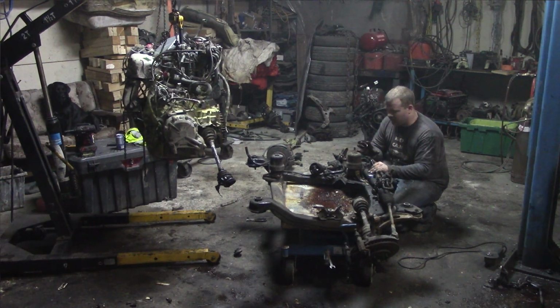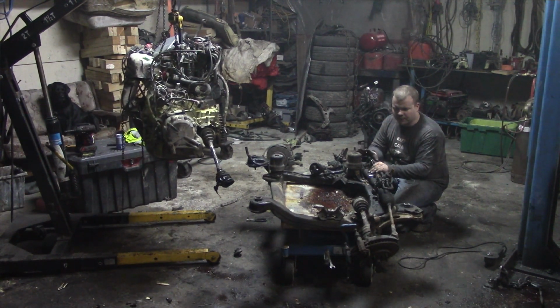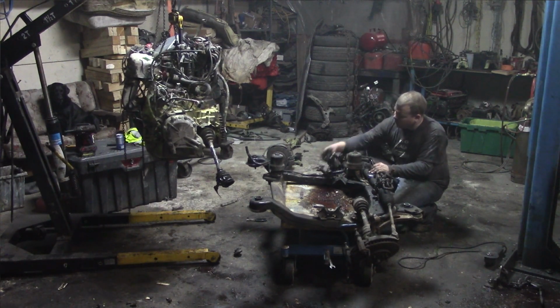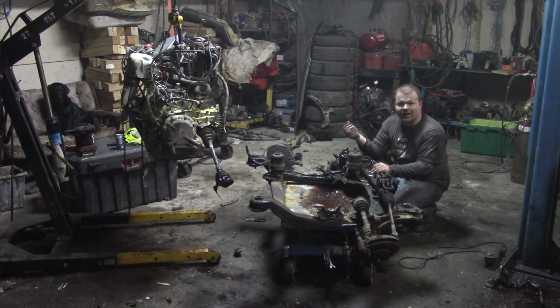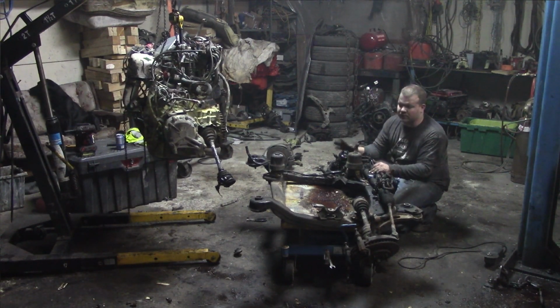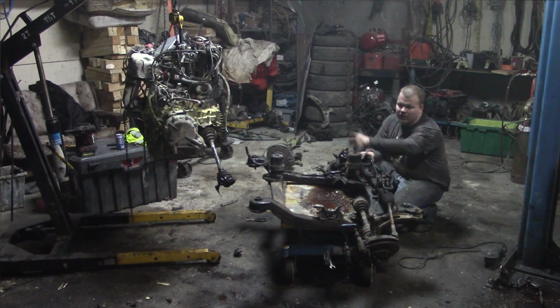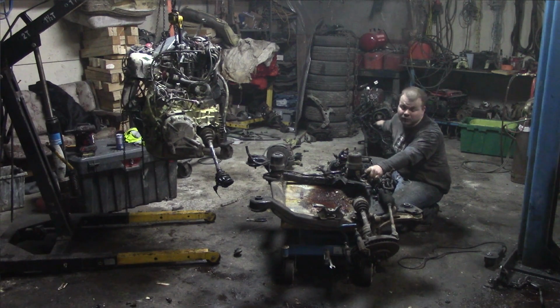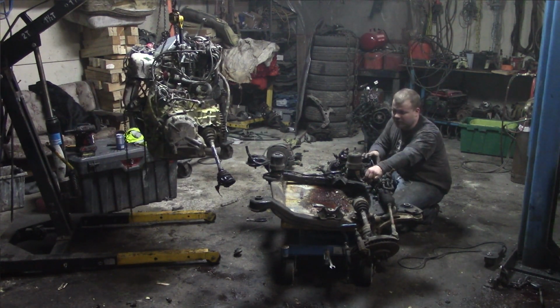Here we are with the old subframe, and what we have there is a new motor. Now, we switched the front motor mount to the older style because I like the older motor mount on the front. And on the back, because we want to use the older axles, we actually switched the back motor mount to the older style as well. That's just for the axle itself going in. Now, I did put the newer style transmission bushing on that side, and that's mostly because the older transmission mount is actually garbage. It's all torn apart.